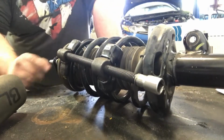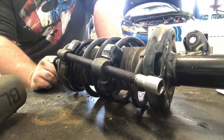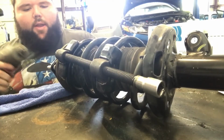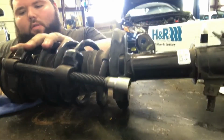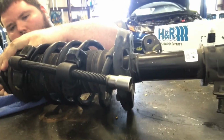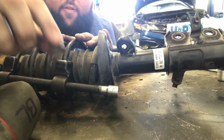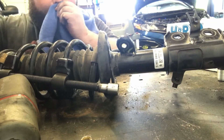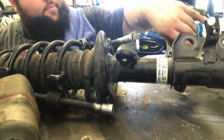Alright, so now I'm going to spray this down because it's a little rusty. I'm going to spray this down with penetrating oil before I take this bolt out. Alright guys, it looks like this is a 17 millimeter. So I'm going to face this way. Alright, so very carefully I was able to get the nut off, and instead of wide open with the impact, I kind of feathered it a little bit. And coming apart with it now.